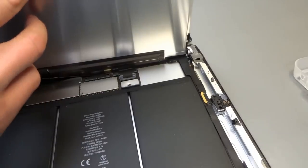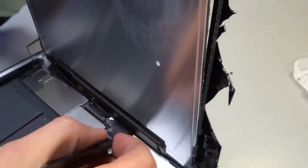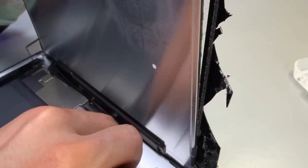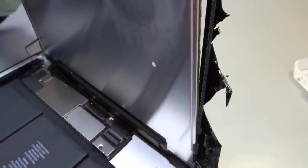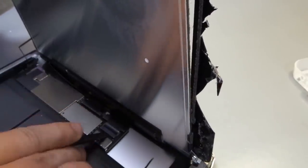We're using an anti-static mat — the grey mat is connected to ground the device. You've got to be ultra careful about static damage: make sure you ground yourself to the device by touching the rear casing before you go inside it, because any invisible static damage can kill your iPad. There's the LCD — don't try to rub glass off right now as you can scratch it. The clasp connectors have a little bit of black tape on each piece holding the cable into the connector. Use tweezers to peel those off carefully.